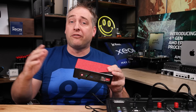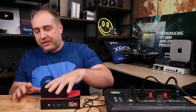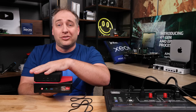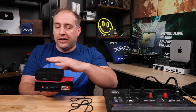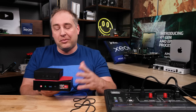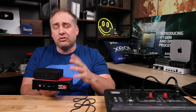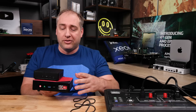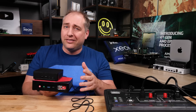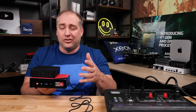One thing that is very different about this versus other systems is the power consumption is actually not that bad. To put it in perspective, this 12th gen Pro NUC — the Wall Street Canyon NUC — will use something like 90-plus watts, so you're talking about a system using 90-plus watts versus one that we're seeing max out around 65 watts. The Intel solution is a little bit faster, but the difference on the same workloads is like 50% more power for the Intel solution. That's why I feel the Beelink team could make this a little bit quieter — that would be a huge benefit.